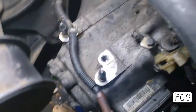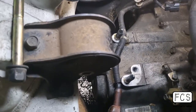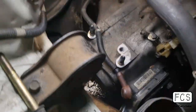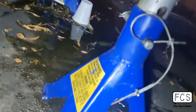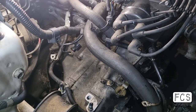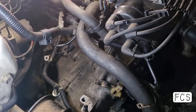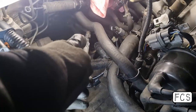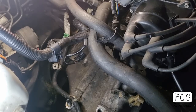This bracket is still missing at the moment because, if you remember, this is a CVT chassis, so the bushing here is different. Gearbox is held up by itself now. Made a huge mess again. It really pays to have the right bits before you start working. So make sure you have the right top mount, the right torque mount, and the right T-bracket as well. Hopefully this helps you avoid making the same mistake as me.